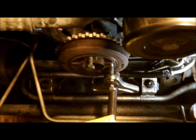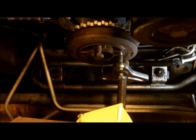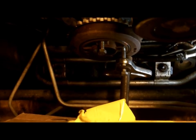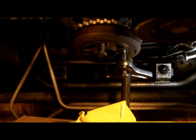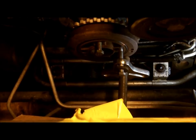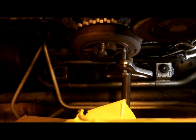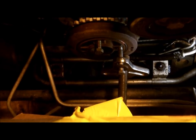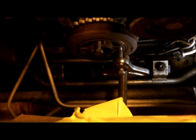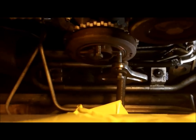Now you see my pie shape puller down there. It wouldn't quite reach in the hole, so you have to ad lib on this style. Work with what you got. I used the bolt, put it back into the crankshaft, and unscrewed it about one and a half turns, and then used my puller. I'm not double wrenching and putting an extra long pry bar on a 9/16 wrench.